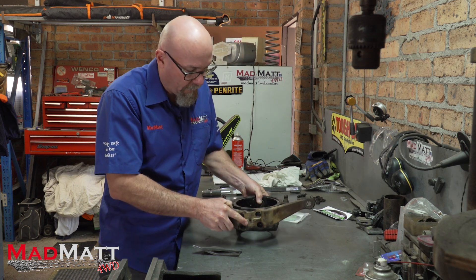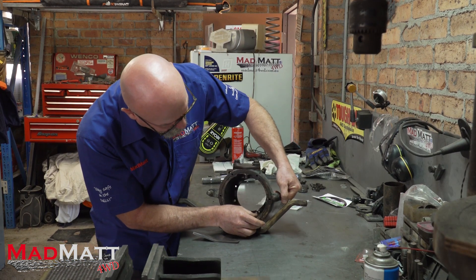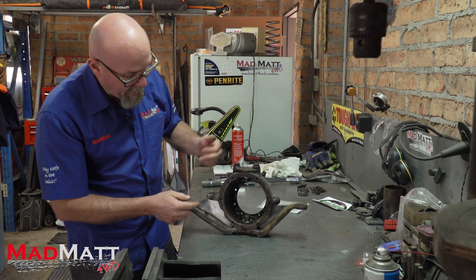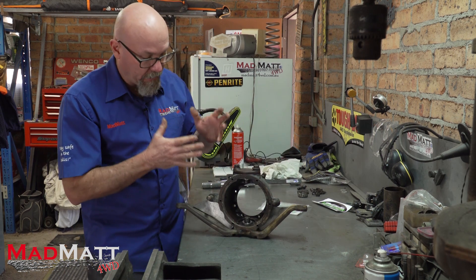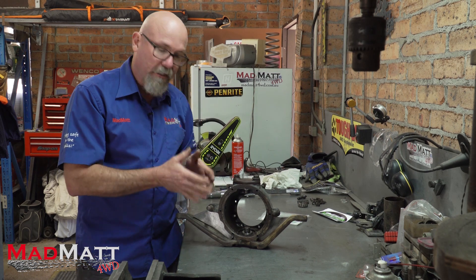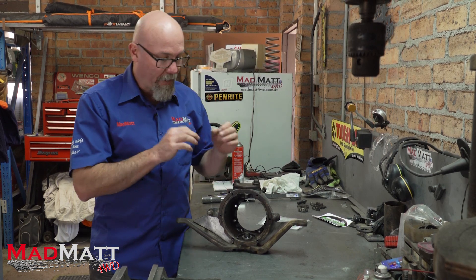So I'll show you how the kit is going to roughly assemble. This piece goes down into there like that, and this one goes down into there like that, then we're going to weld all of this up. You can see how we've taken steel to really engage this arm into the whole knuckle housing — that's going to make it extremely strong once it's all welded up. Now the procedure I've never done before is welding cast material, because all of these have been cast.